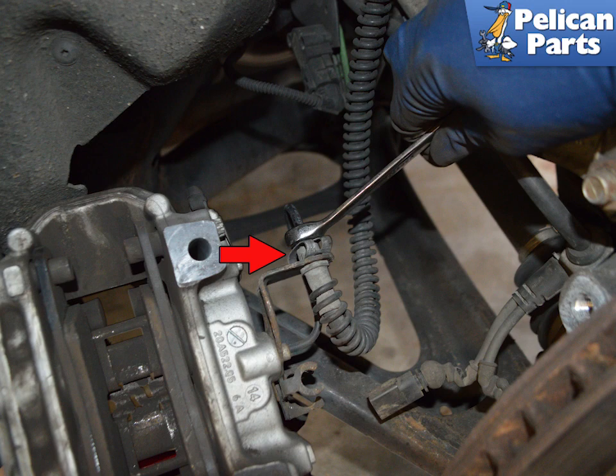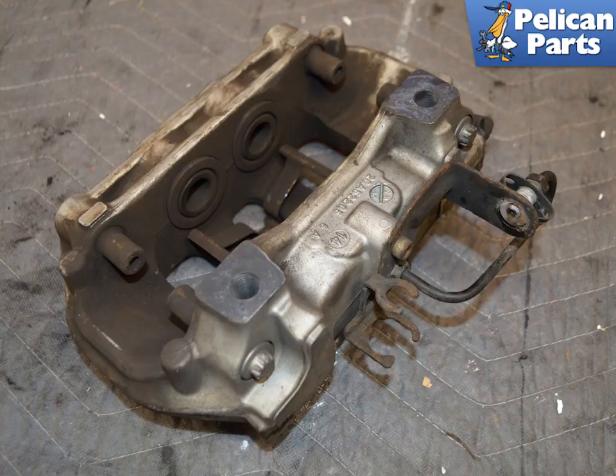Once you break this connection open, brake fluid will escape. It is slippery but most important, deadly to your paint. Do not get any on your paint job. Have a rag ready to catch any brake fluid. It's a really good idea to cap the hard line while the flex line is off. This will help protect the line, stop debris from getting in, and keep fluid from getting out. You can now move the caliper to a flat work surface.